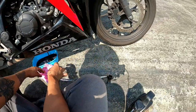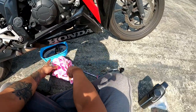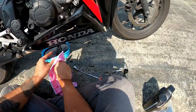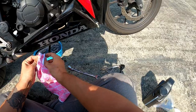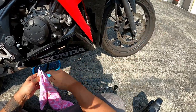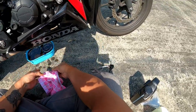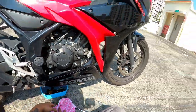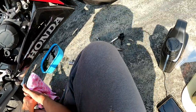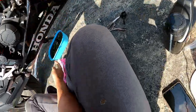There you go. Don't forget — the nut sometimes has a washer. You may lose it into the oil, so you'd have to fish it back out. That's why you have a cloth underneath. If you've never changed your own engine oil, it's nice to just do it yourself at least once for the experience, and then other times you can just send it back to the shop. I know I normally don't have time to do it myself — I'm just showing you guys. So anyway, it's still dripping. I like to move my bike a bit so whatever excess oil remaining will drain out.